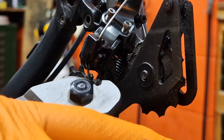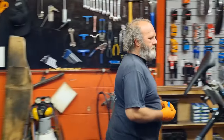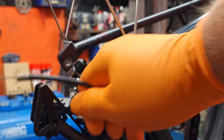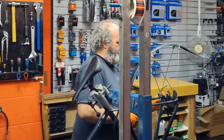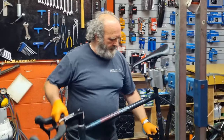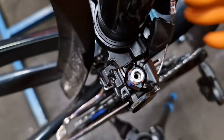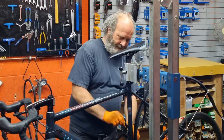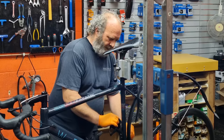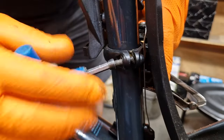Then clip the cable end off the rear derailleur, undo the rear cable just enough so we can drag the inner out of the derailleur. Get a 5mm allen key, undo the derailleur and pull the bike back. Get the cable disconnected by twisting it. We're not taking the cable end off because it doesn't need to come off to get the cable out of the derailleur - so we can keep it at the same length later when putting it back together. Undo the front derailleur clamp.